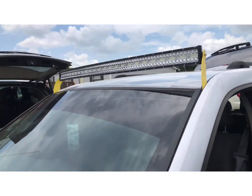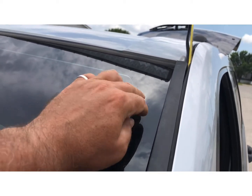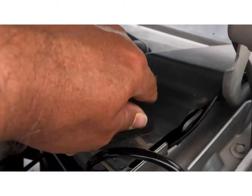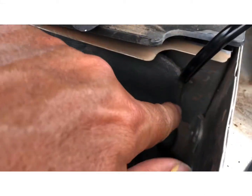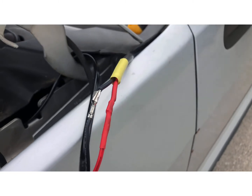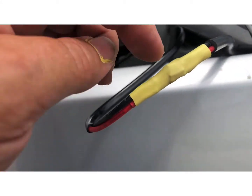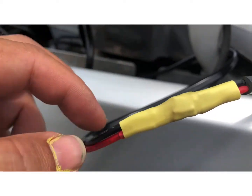Gotta connect the power to this light bar. I have run the wire behind this and in front of this — so between the glass and this plastic trim — down through here. It's gonna come under this piece into the wiper motor assembly housing. Drill the hole through here so that the main wires can go in and connect. Connecting each wire with some heat shrink tubing to keep water out and keep the connection alive. I've got the hot wire, which is the red wire, separately insulated away from the ground. I'm using this yellow one to insulate both of them together, but the ground is only insulated by the yellow one.